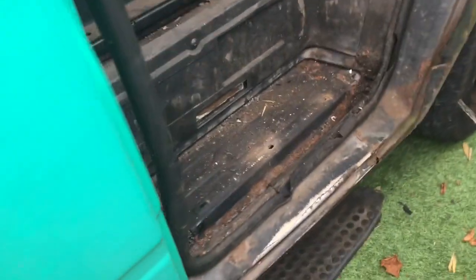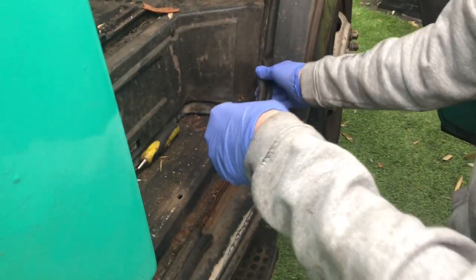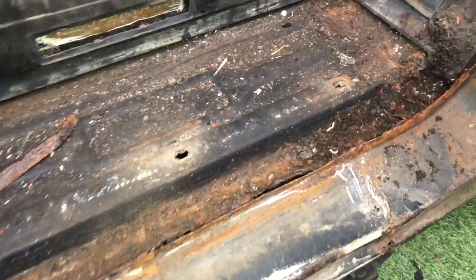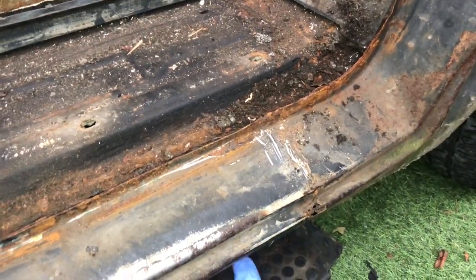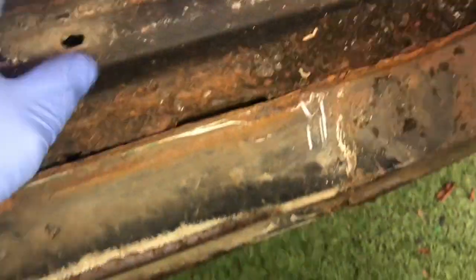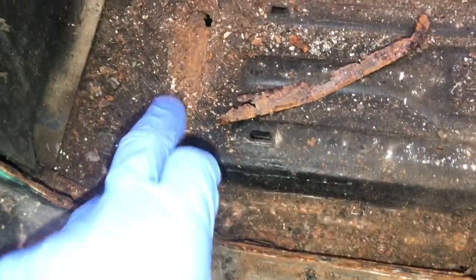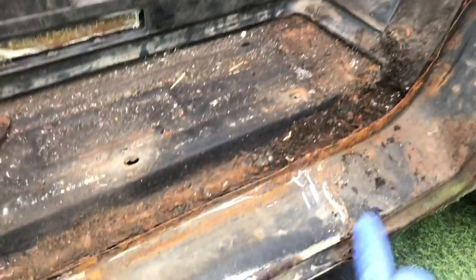It's actually not that bad — I don't know if you can see in there, the step's not bad. I'm going to need to get a new door rubber. The welding needed is a bit worse than I thought, so what I'll be doing is putting a plate here, maybe a little bit closer over here. I'll weld that full panel — I'll have to do a couple of bends, so probably a seam at some point. On the inside it's gone a little bit. Eventually I am going to put a new step in, but I'm not sure whether to just patch this for now to give it some rigidity or leave it — I'll decide once I get this section out here.